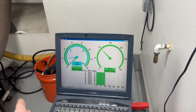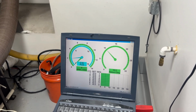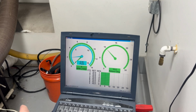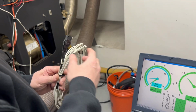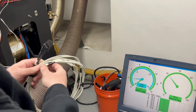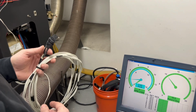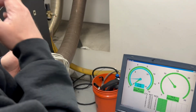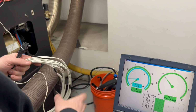So what I'm going to do is turn the knob, and that's going to actually simulate RPM of the engine. And while that's doing that, when I hit the button, which is going to be this for the nitrous, we're going to be able to see that the timing is retarding in here. And that's the check that we really need to know, because if we were to run the engine and spray the engine and the timing didn't come out, like I said, it would burn the engine up. So this verifies that part of it's going to be safe.